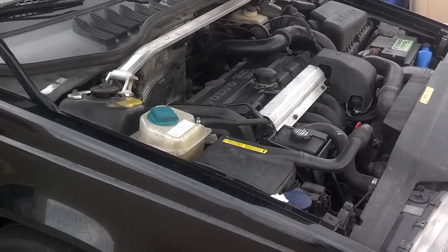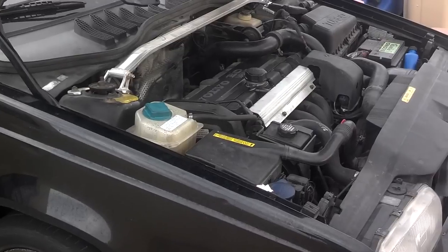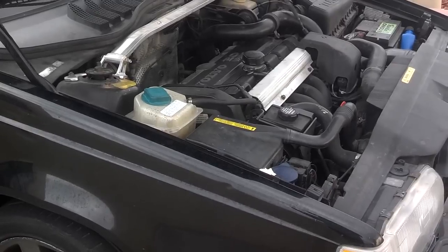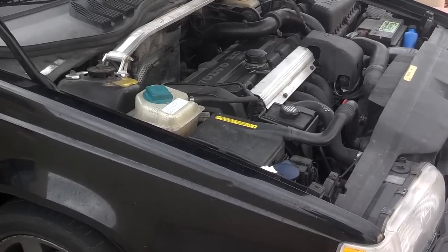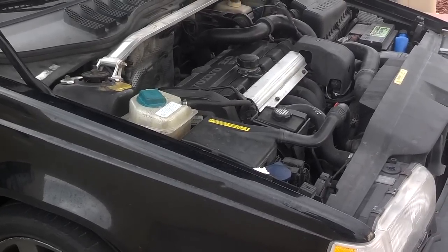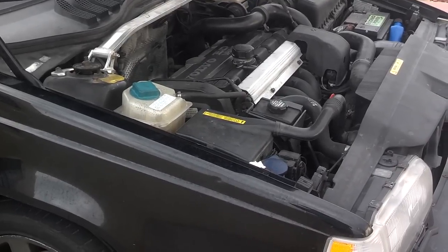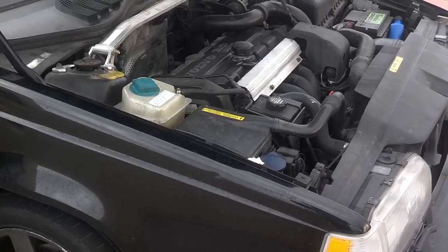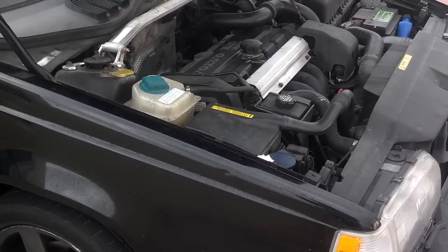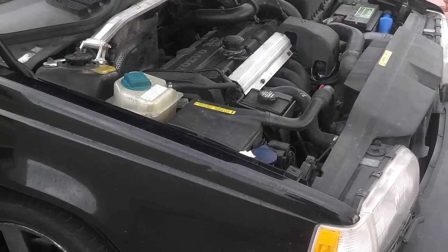The third thing you want to do: don't put strain on your turbocharger when your engine is cold. When your coolant is cold and your oil is cold, you don't want that turbo getting too hot. Don't put pressure on your turbocharger until your engine temperature is at its normal operating temperature. Normally, the first couple of miles after starting, I don't put a lot of load or pressure on the turbo. Don't overwork your turbo when the engine is cold.